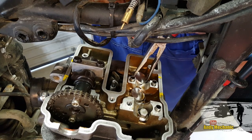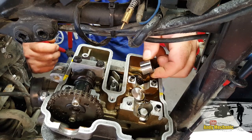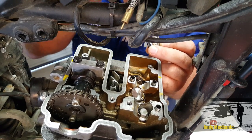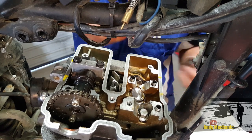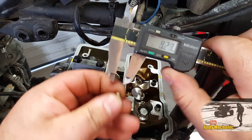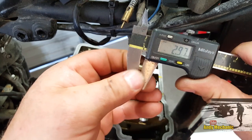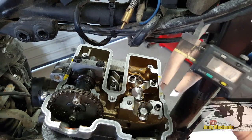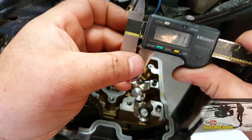What you're going to need is a pair of long nose pliers, and very carefully lift them out — try not to damage them if you can help it. Maybe a little bit of rubber hose on the ends of your pliers is a good idea. We'll just pull that outer left-hand bucket out to expose the shim. And inside there is the shim stuck to the bottom side of the bucket. The one that's come out measures 2.95 — and the one that's going to go in should be 2.80.